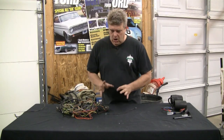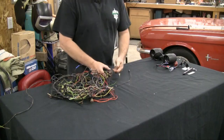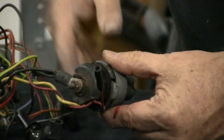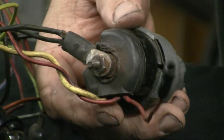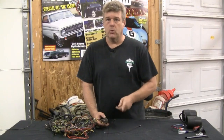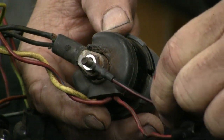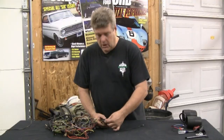Now let's do a little Mr. Rogers pretend — say this is our ignition switch in the dash. This is the red wire you'd normally use for your ignition going out to the car, and you'll see a stud on the center back of the ignition switch. I would not go and remove the brass nut on here because I've stripped these out more than once — after they get some age on them, they can take a seat and you won't be able to get them off. I'd recommend getting a 10-32 nut and putting the black with red wire that comes with the kit on the stud with that.